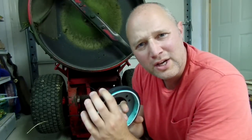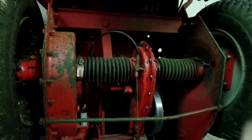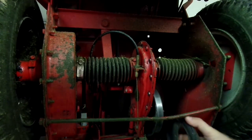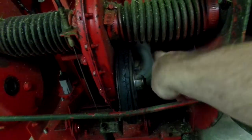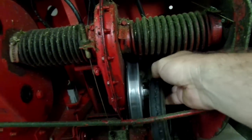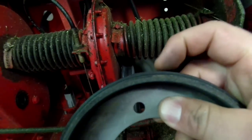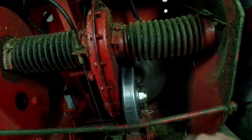I'm going to show you what this does and then we'll go through. I'll recreate taking this one off and we'll put this one on. As you can see, I've got this thing turned up on the back. These are the two wheels, the back of the mower underneath. This is where this drive disc was attached right here. Up in here there's another disc, and this is where the pulley is — it's connected to this disc. As it turns, it actually operates the momentum of the vehicle, it makes it go. As that exterior lining wears off, it just does not have the force to propel the mower up inclines, and eventually it'll just stop moving altogether. That's what we're going to fix.